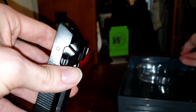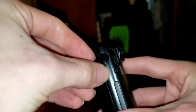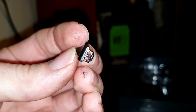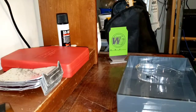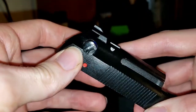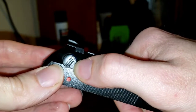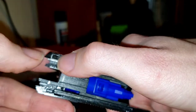Now you're done with the screws. This part will now slide off — this is often what people think has broken, but it just simply falls off because those screws aren't held in by much. This leaves you with this. Now in order to get this side off, you must first disconnect the little flathead in there, as it holds on to the lever bar that actuates this section here.